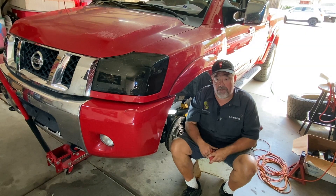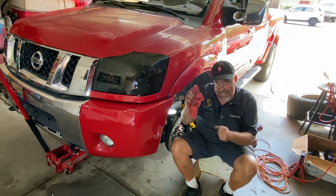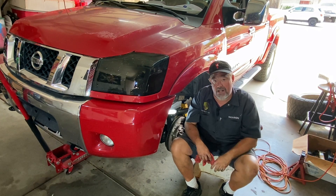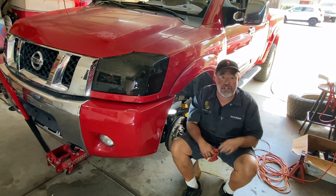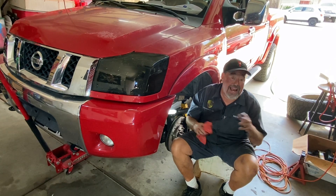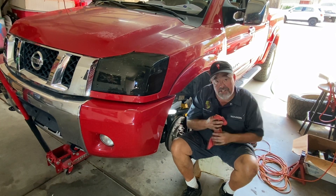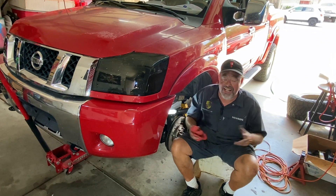Alright guys, that's going to wrap it up for today. You can see it's pretty easy to drop that top ball joint, get out that old strut, put that new strut in, torque it down to 22 on top and 100 foot-pounds on that bottom bolt that goes through, and you've got yourself a set of new shocks for about half or more than what you'd pay if you take it to a shop. So with that, I'm going to let you guys go. Please enjoy your afternoon and I'll see you next Tuesday for another Titan Tuesday video.